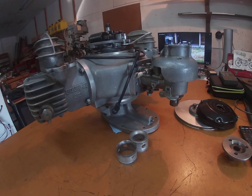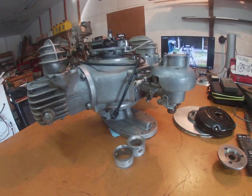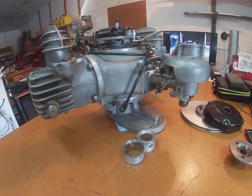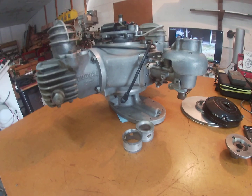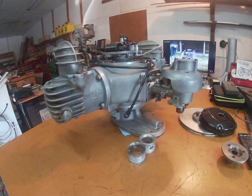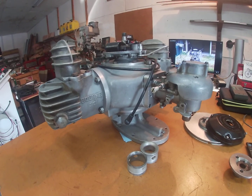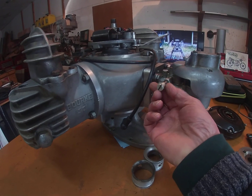Originally it was an outboard motor — it's still on the outboard motor base. One of these days I'll find an old Evinrude mid-50s lower end and see if I could restore it to complete as an outboard motor. But this is how I bought it, and I didn't have much choice because he didn't have a bottom end for it — it had never been on a bottom end. As far as it was run, according to him, only one time. It was pretty well carboned up, and I figure that this needle problem in the carburetor is what got him.